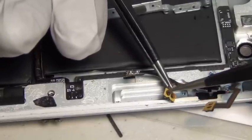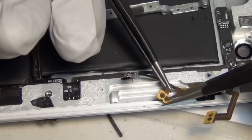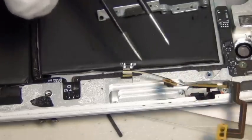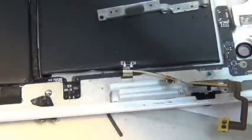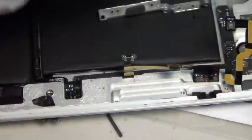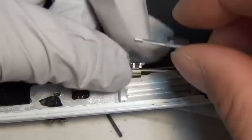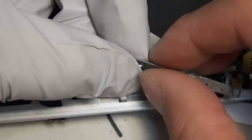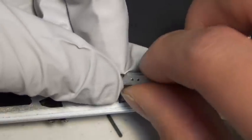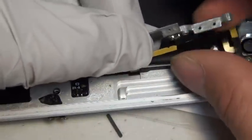Be careful. Use tweezers or fingers. You don't really need to wear gloves for this one or anti-static protection, as long as your battery is not plugged into the logic board. For iPad 2, the entire back metal frame is electrically conductive — it's a ground. So whatever discharge you generate goes straight to the case anyway. You're not going to generate enough electricity to damage anything at all, especially with these parts, when the battery is not plugged in.